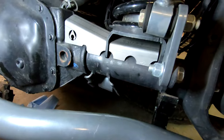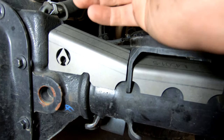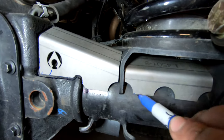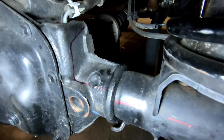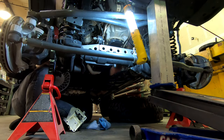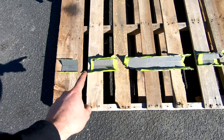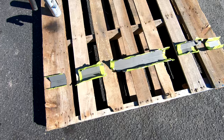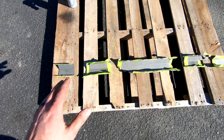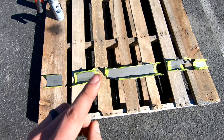In order to get a good weld, we're going to grind off the paint. The easiest way is to come in with a Sharpie and mark where we need to take paint off on all these pieces. I went ahead and taped off all the pieces of the truss and shot the insides with some paint to help prevent rust, because it's going to be pretty hard to paint the insides once it's welded onto the vehicle. While that's drying we'll go back and start prepping the axle housing.